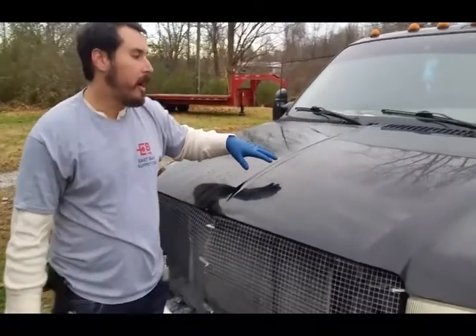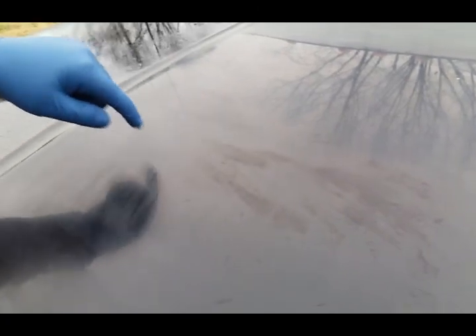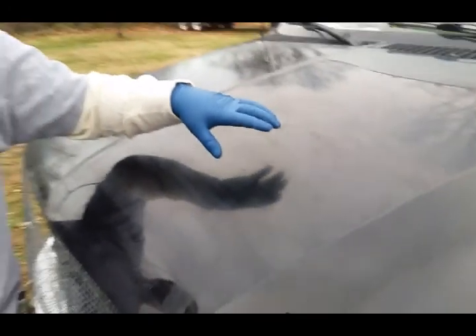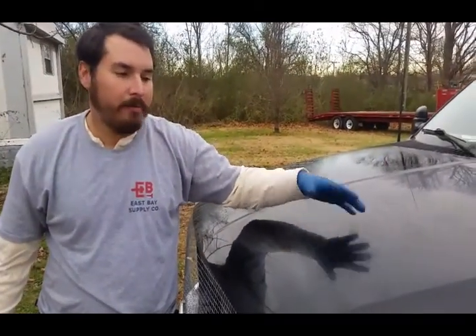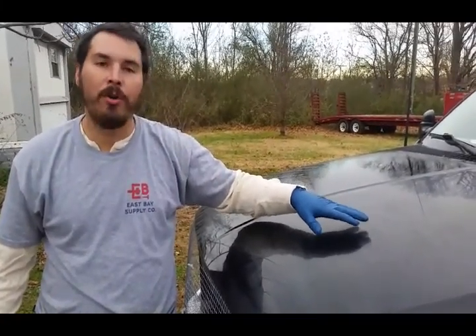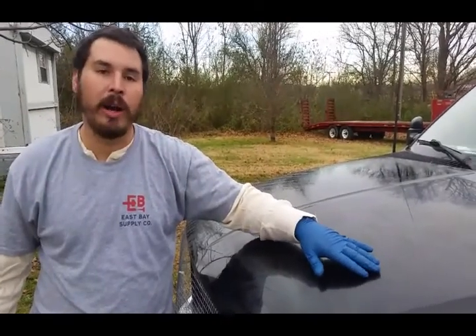If you can see the haze — there are some low spots I've got to go back over, and there's a big line down through here. But what I wanted to show y'all is that little square and two shapes, whatever they are — pie pieces — they're still partly here. That's because when you're wet sanding with 2,500 grit, that's not aggressive by any means on the scale, but you still want to try to leave as much clear coat intact as possible. My goal is just to remove that spray paint.